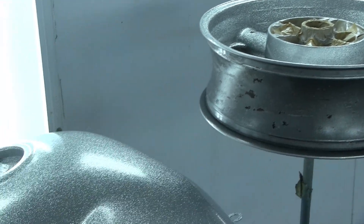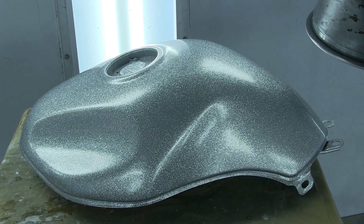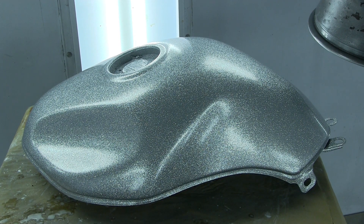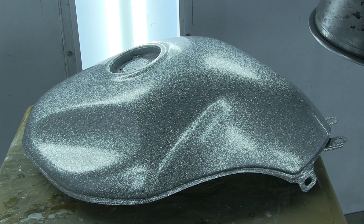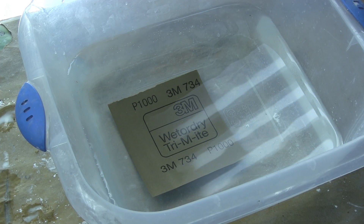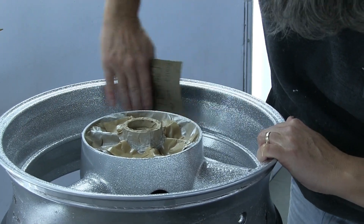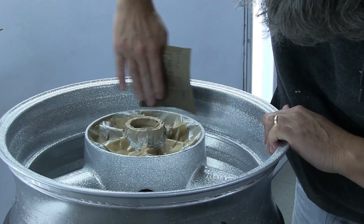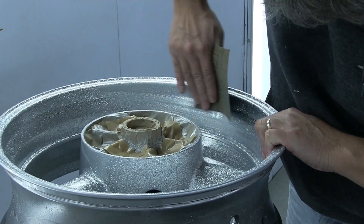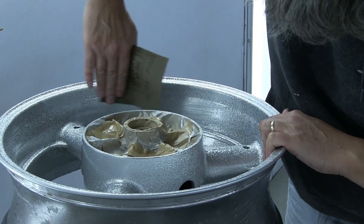I've cut to the chase a little bit and I've actually cleared my rims and my bike — don't worry, I'm going to show you all of this later in the video. This is just to get to the next stage, get the wheels painted and put back onto the bike so I've got a rolling chassis. This is done with a 2K clear coat and left for at least two days. So I'm using 1000 wet and dry, and it's very very important that I have enough clear coat on so I do not sand through the flake — particularly important if you're using coloured flake. I'm just taking the 1000 and getting this as smooth as possible, making sure there are no ridges, edges, or high flake sitting in there.